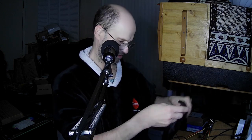So you can do it one of two ways. You can do it with just this and this, or you can do it with just this, in both cases where the motherboard supports 5 volt ARGB. And then you connect your fans here. So I'm not going to use the SATA. Instead, I'm just going to show you what you would do.